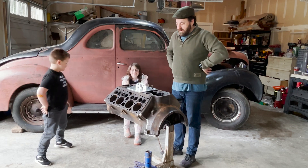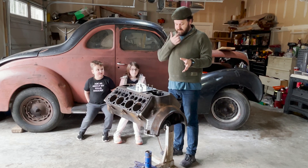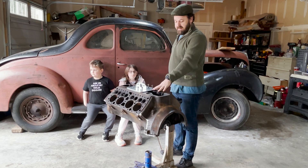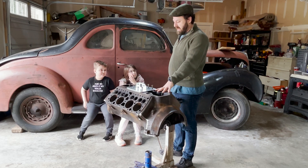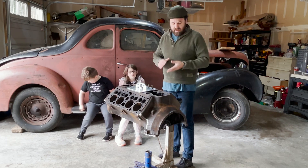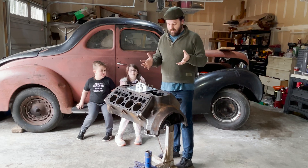What we're going to be doing today is we're going to remove the old practice engine block from the engine stand, put the new one on so that we can paint the intake manifold runners with Dykem so we know how much material to take out matching up to the intake manifold gasket. And we're also going to be beginning the work.